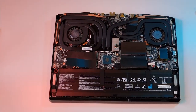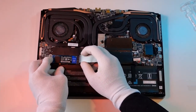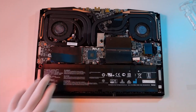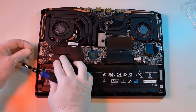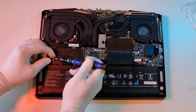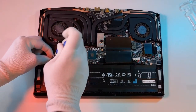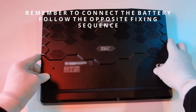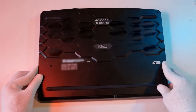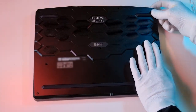Place the SSD in the slot and listen out for that beautiful sound. Put back the fixing that was there on the motherboard. Then reassemble the bottom cover — again, be extra careful and gentle with this. It is really satisfying when the clips clip back in.